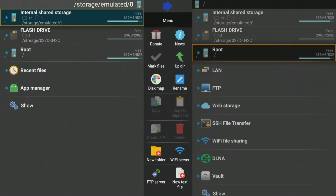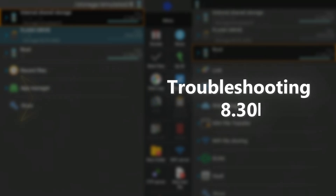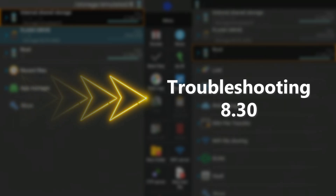If you're using a Fire Stick running an older version — less than Fire OS 7 — here's the point in the process where you stop. You won't be able to see or access the USB drive from within the Fire Stick settings. Instead, you should be able to open a File Explorer app like Explore to see and manage files on your USB drive. If it doesn't appear, use the clickable sections to jump to the troubleshooting tips section in this video.